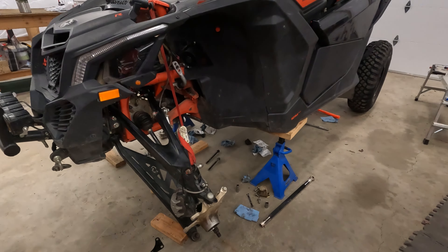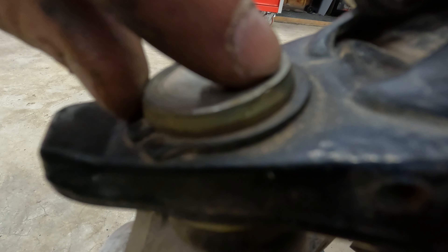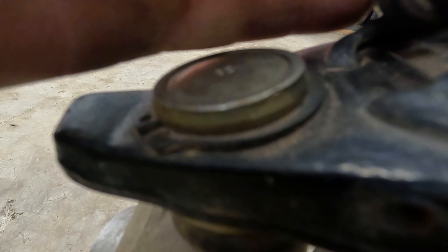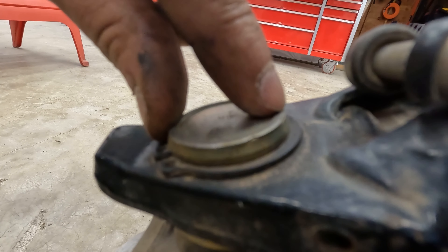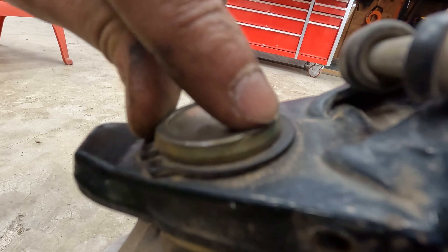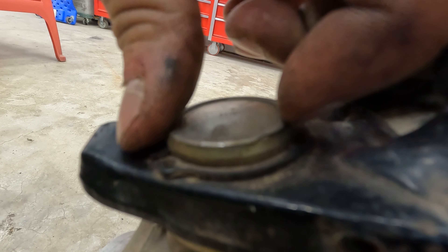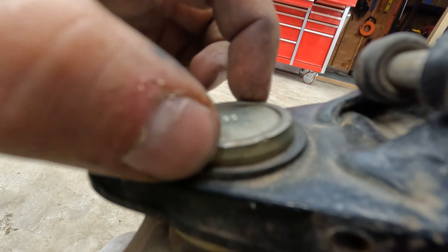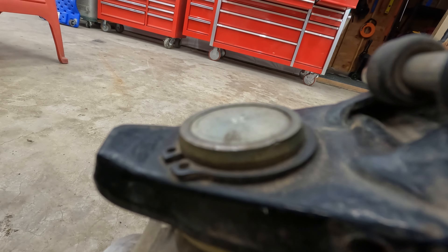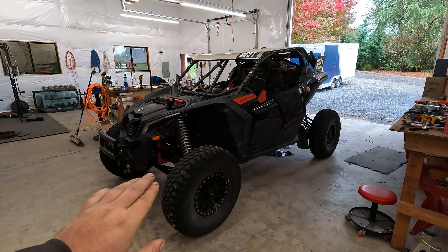This is the kind of stuff you should be looking for when doing pre-race prep. The top of this ball joint is actually starting to crack right here around the top edge. That's the kind of attention to detail you need during pre-race prep, because that right there would end a race. You can hear it — grab right there and you can see it open up. Half of it is cracked all the way across.